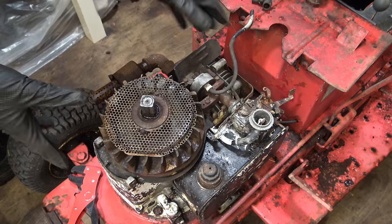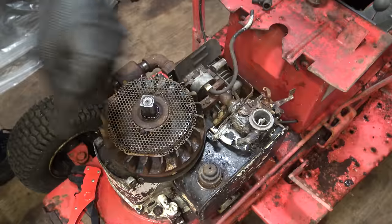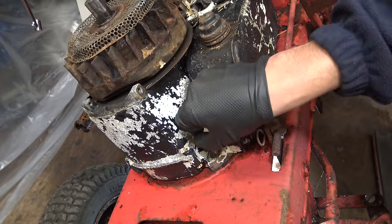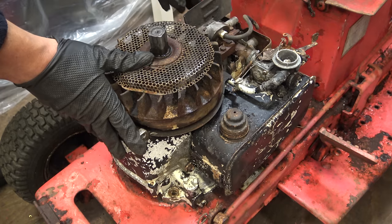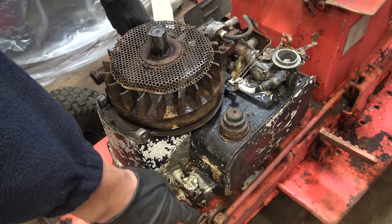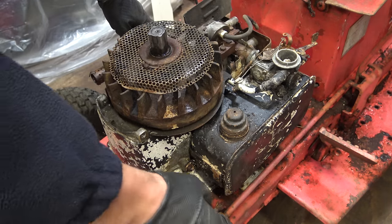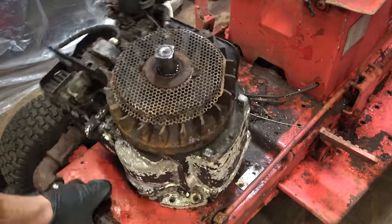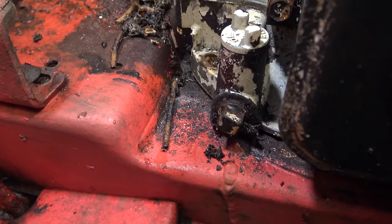But yeah, next I'm going to unbolt the engine, turn it around so that we can have a look inside the head. And the carburetor is going to be a problem because that is absolutely filthy in there. The belt is still connected underneath, but I'm hoping I can just turn it on the pulley. Also, the oil drain, because it's not the original engine, is in a really bad place just there, opposite the engage rod. So I'm hoping I can drain it when I've rotated it. That is in a much better place.